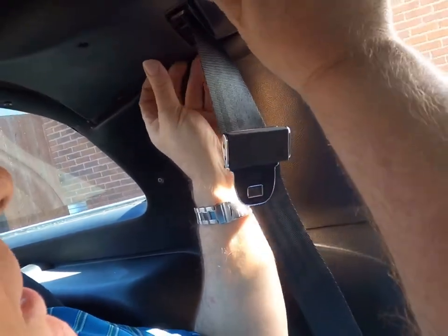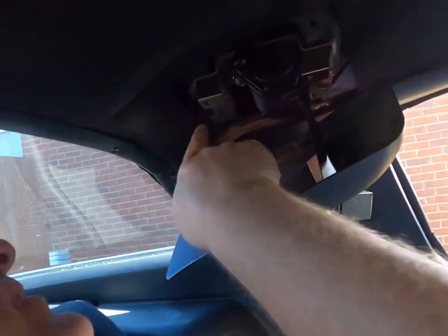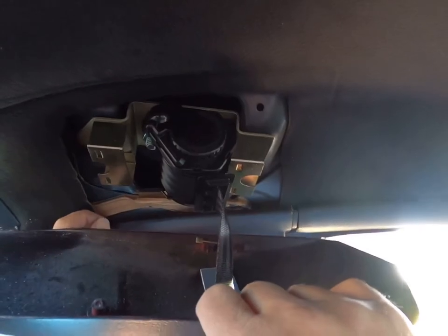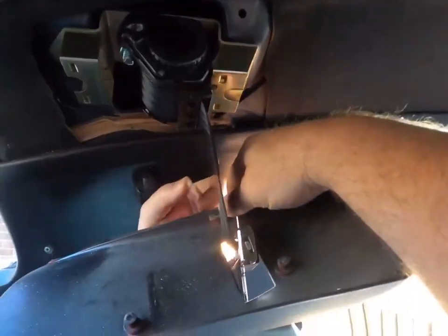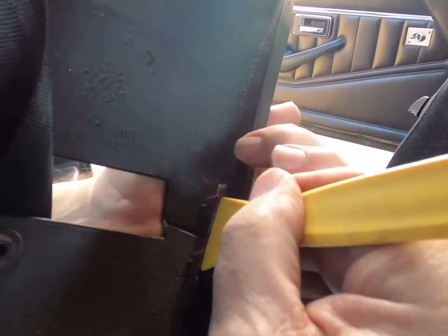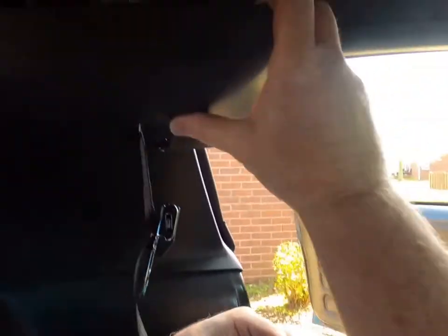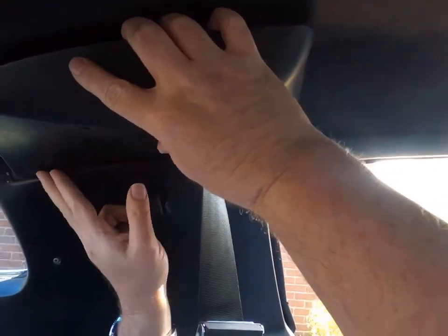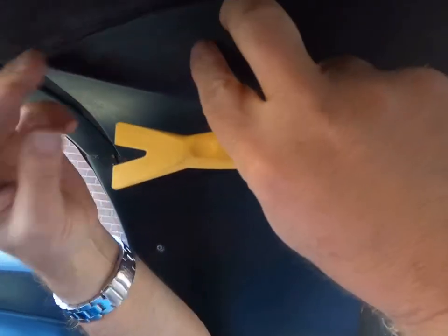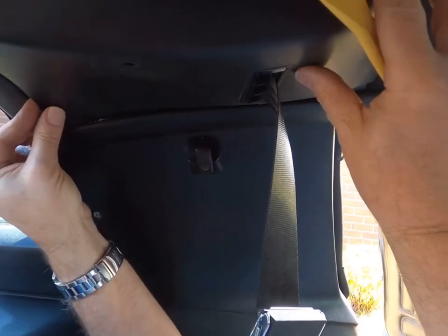Before I snap that in, I'm just going to make sure this goes the way I want it — and it looks like it will. These holes have to line up on the seatbelt reel. They have different tangs depending on different applications, so you're going to have to work that sheet metal screw into that folded-over rectangle. So this one goes there and there, and then it just tucks in underneath this piece of trim here. I'm going to be careful with this 40-year-old plastic, especially when it's been dyed — I think this car has like two or three different donor cars here, various colors, red and brown and whatever.